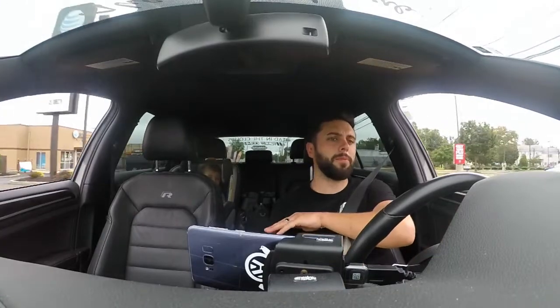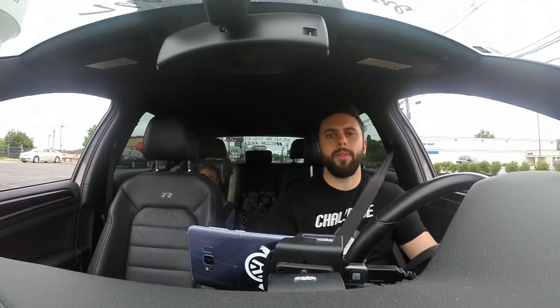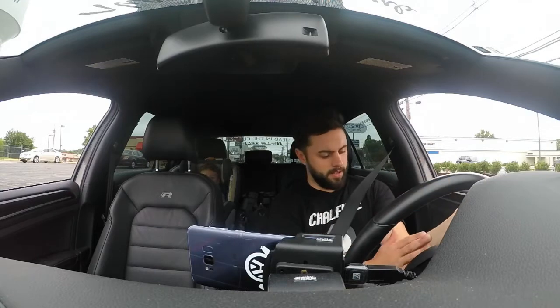To me, it meant you're getting a little bit more power than you would on the stock tune in first, but first gear's so short that it's not really going to hurt it, and the clutch slip is going to hurt your times way more than that little bit of extra air going in for a little bit more power. So all I did was limit first to 19, no clutch slip at all, and the car ran its fastest time so far.